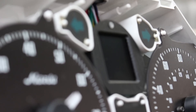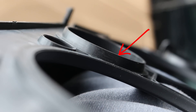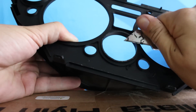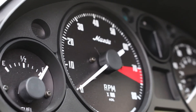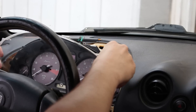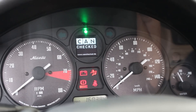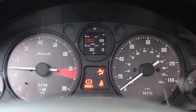There's a small fitment issue during reassembly: the stock oil pressure gauge is recessed deeper than the CAN Checked, and the gauge ring on the face plate is deeper. Trim the face plate down little by little with a razor blade, test fitting each time until it fits properly. It's not perfect, but it looks fine.